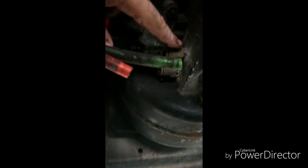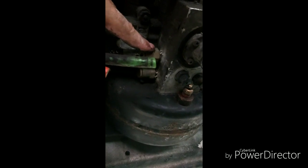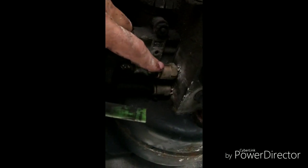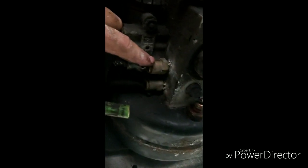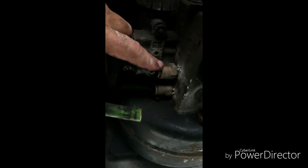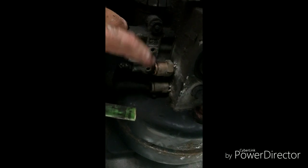But normally, if you gotta open up these systems again, or unhook them lines with those compression fittings, you have to replace them, but they're only about $2 or $3, as opposed to these things here. Some of them can run all the way up to $30. So there's you a tip about some of these fittings. If you're at the house, you find a bunch of leaks on your truck, and instead of going all the way to a truck dealer or Peterbilt dealer or Freightliner or whatever and getting these fittings and having to order them, you can just go to a hardware store, pull this out, and get a compression pipe thread fitting that'll fit that.